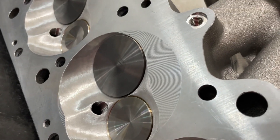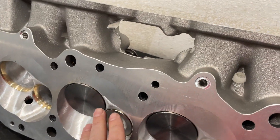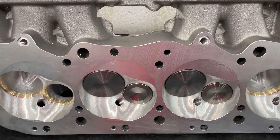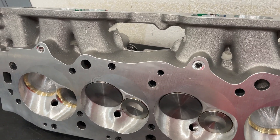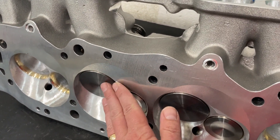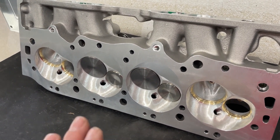Another option — which you can kind of see here — is the chambers are CNC softened. The reason for this was two reasons. One, it really makes it better for detonation resistance because you have a flame front that goes further out and gets some of these end gases burnt, so they're not causing detonation or pre-ignition conditions — a huge advantage. The second reason I've heard is that it can make a little bit more power, because if you put two flat plates together and try to pull them apart, it takes considerable effort. Having this dish here helps make a little bit more power. But the biggest thing is detonation resistance — on a street-driven deal, we definitely don't want any detonation problems.